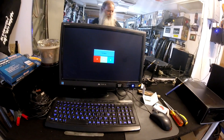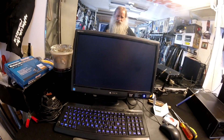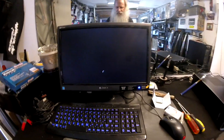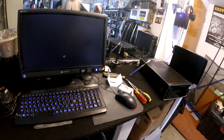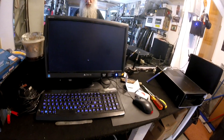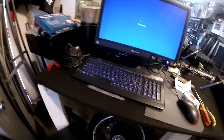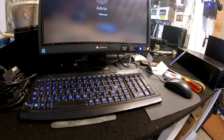It's already detected that CPU — I like that, that's a nice Intel board. She's going through some stuff. This had Windows and a spinning drive, so it's coming up — that's the Windows spinner. Originally it was a dual core Pentium. You can pick these things up all day long for probably less than 75 or 50 bucks on eBay, drop in a half-decent i5, i7, or Xeon — as long as it fits the socket and it's the same generation the microcode's gonna work. Make sure your BIOS is updated, that's all you really gotta do. So now we're up and running.